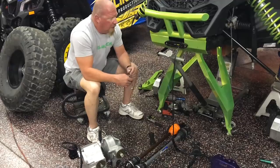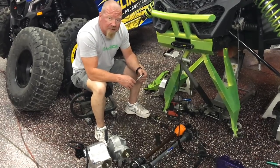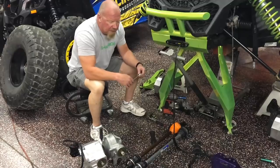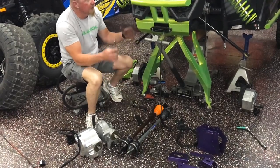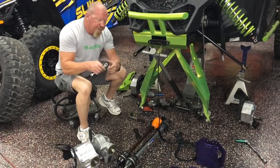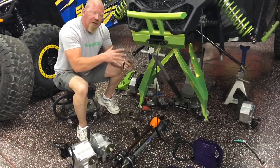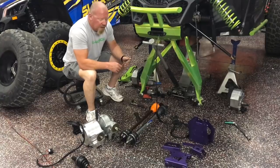The other thing I don't like about these Can-Ams is the A-arms. The way the front end is set up, a lot of the parts are single-sheared, so they're inferior. The A-arms that come factory on these cars are like tin cans — they fold really easy. So you upgrade your A-arms, put something beefier on them, but if you hit something and they're not double-sheared, it's really easy to take out the front end. I picked up a CT Race Works reinforcement kit — basically all these brackets go back in the car and make everything double-sheared. With double shear, if you have a bolt that comes through and your A-arm slides on it, there's nothing on the other side floating — this kit eliminates that and makes sure every bolt and every component is double-sheared.